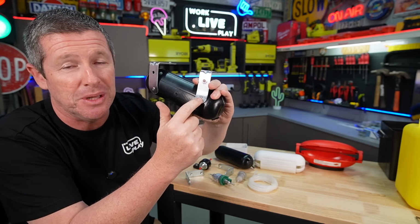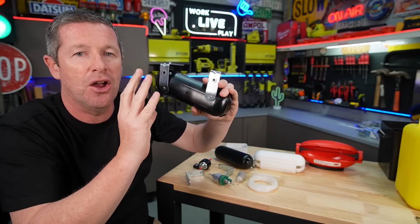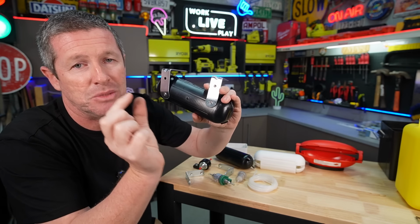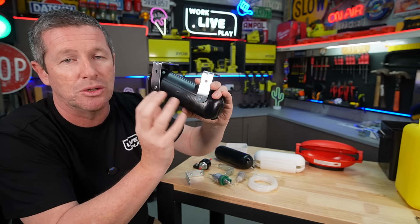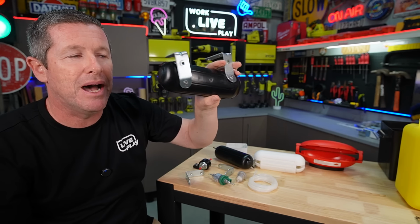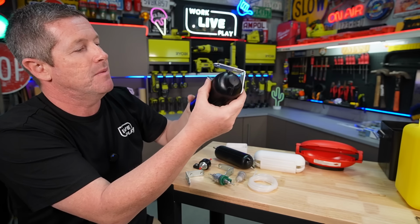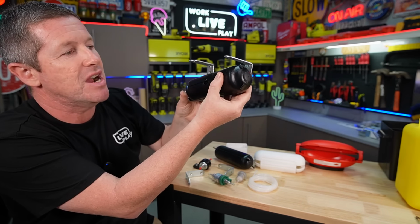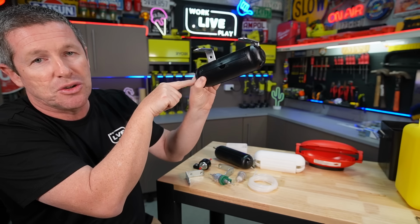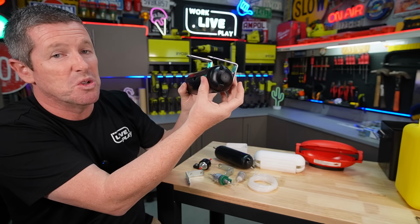And I'm just using some simple M5 bolts. At the moment, I've got these ones in here, but I bought some slightly longer ones, so I'll list in the description below the ones that I used. And I'm using some Nyloc nuts to squeeze it all together and make sure it doesn't vibrate apart when we're traveling down the road. But this to me will be a real neat and tidy solution that once it's bolted in place, it's non-obstructive. Your fuel line goes in, it comes out, and we're going to run the electrical harness in the bottom side as well. And it shouldn't really cause too many dramas.